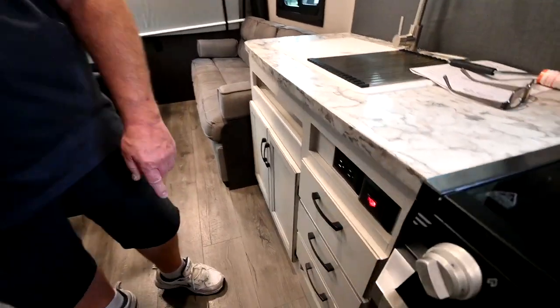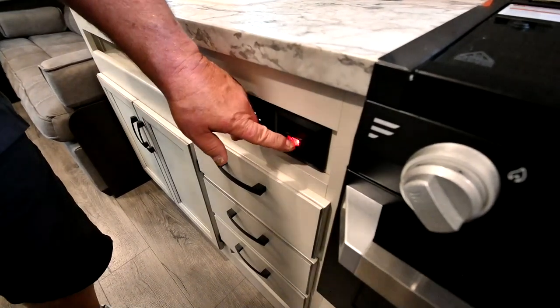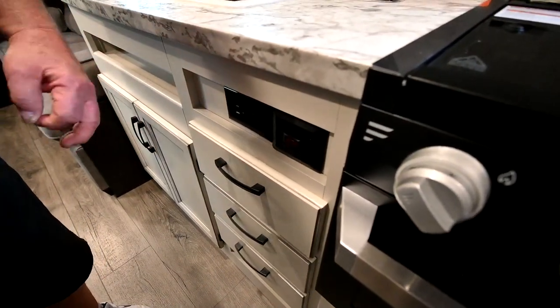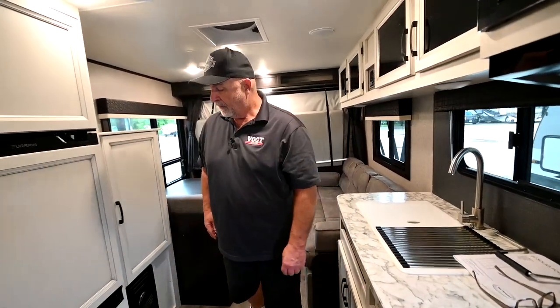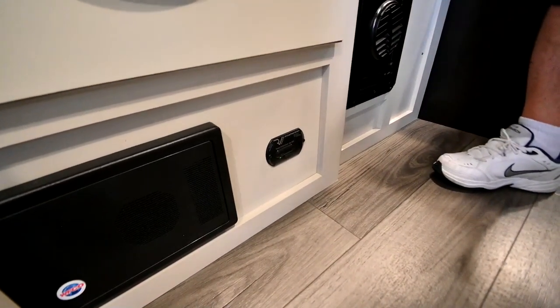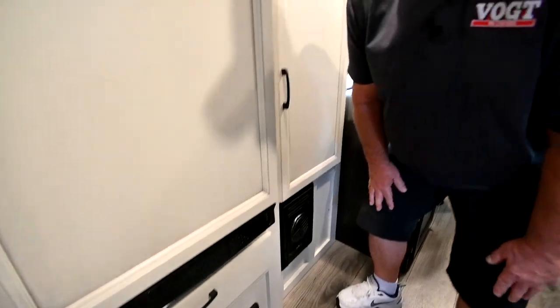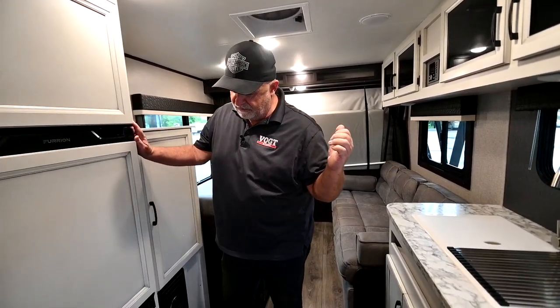This switch right here — in the on position the red light comes on — that heats your tanks in extreme cold so they won't freeze. It's not enough to make them hot, just barely enough so they won't freeze on you. This thing right next to your breaker box is a propane leak detector. If you have a propane leak, that's going to beep like your smoke detectors do. Come over here to your stove, make sure your handles are turned off, go outside and turn your propane bottles off. If you still have a leak, your batteries are probably going to be really low or dead — that's the other reason it would beep, because it's wired directly to your batteries up front.